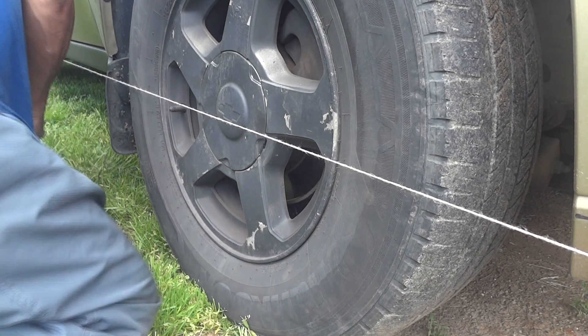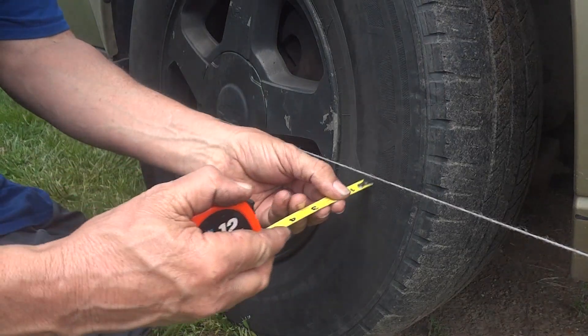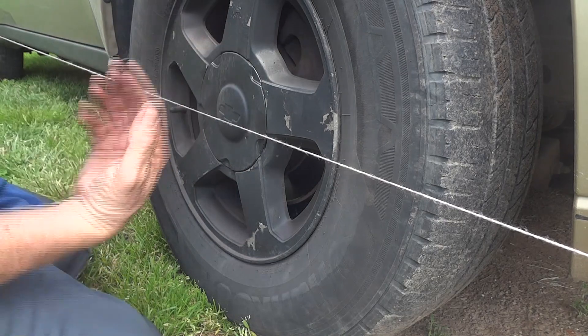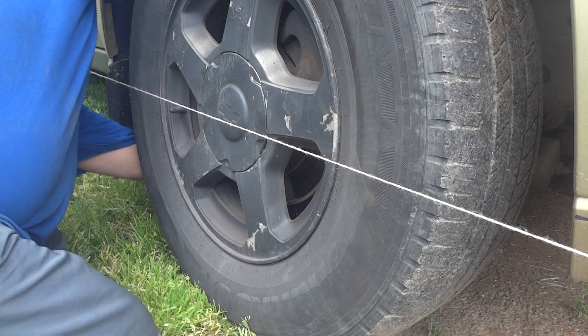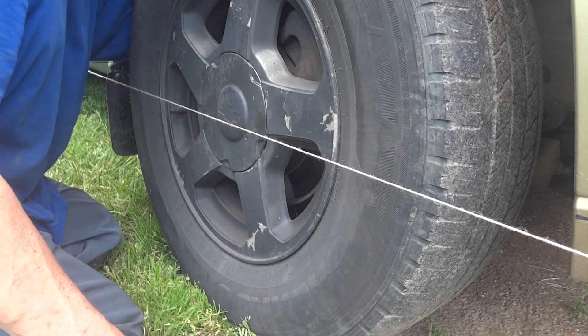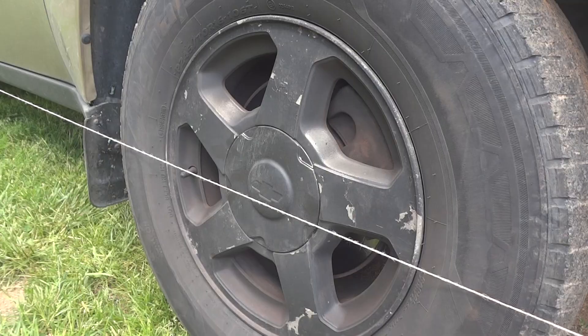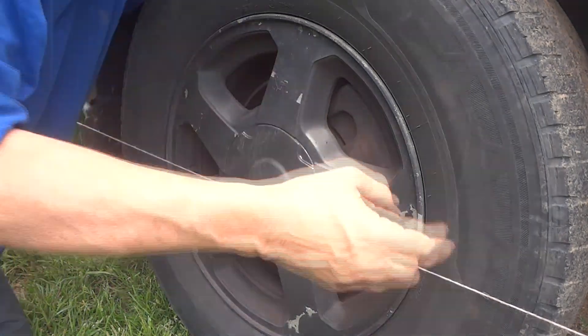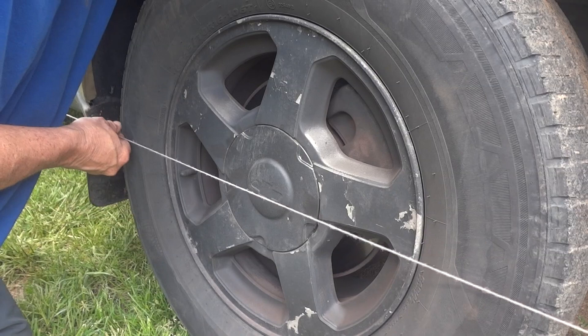This one is about a half inch so I'm going to go ahead and make the adjustment. I'll put my wrench behind here and turn it — I need to figure out which way to turn it; you'll just have to turn and see if the tire's coming in or out. I'll start turning and watch the tire. Make sure your arm or clothes isn't hitting the string without you knowing it.